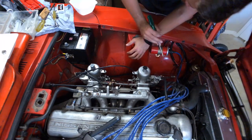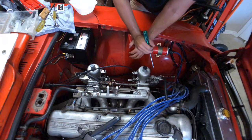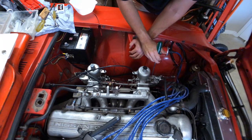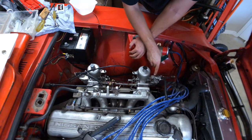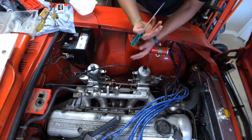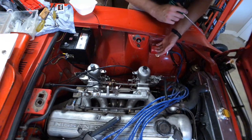Some people might wonder why these use screw threads and not bolts. That's because you're dealing with soft alloys — if you had a bolt head there, you could do it up too tight and strip the thread. It's also worth noting that with the screws on the float bowls, there must always be a metal washer under the screw. On the side with the tab that holds the fuel line, that's metal. The other screws also have a metal washer — make sure you don't get them mixed up, because not all of them have a washer. That's because with soft alloy, it's good to have a metal face against it; otherwise if you keep tightening the screw, you might scratch out the alloy.